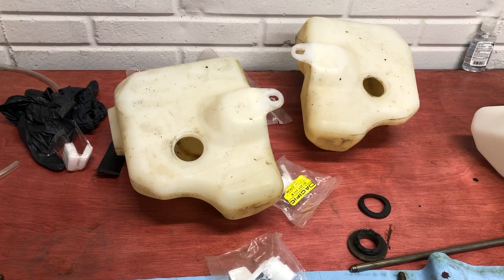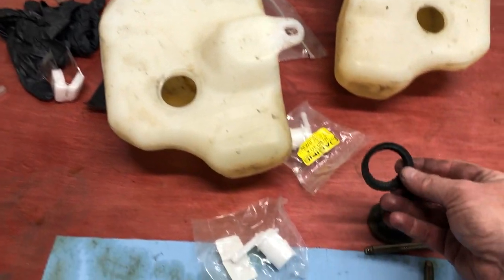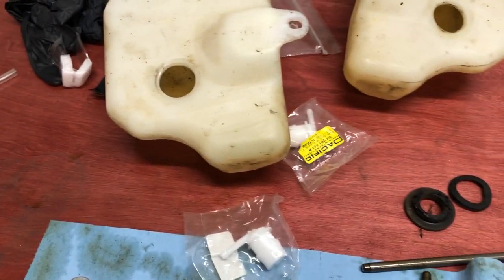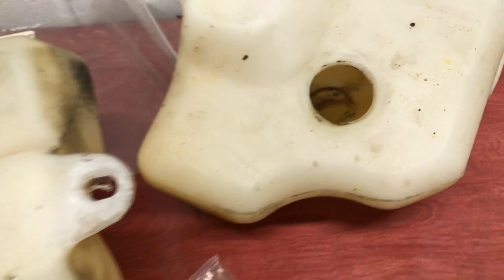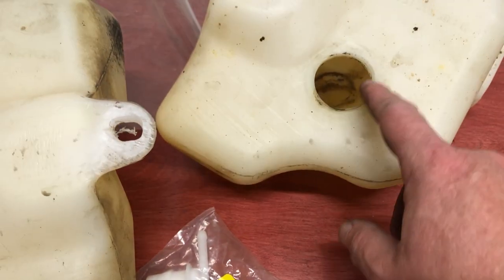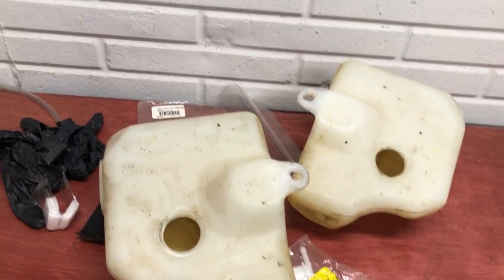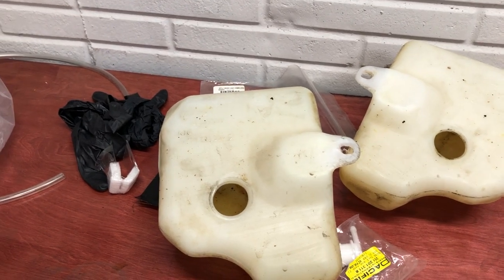Your grommets are probably crap. Case in point, here is one of the grommets from mine. One part of it I think I may have even thrown away, but you can see inside this tank the fuel grommet had completely dropped off the hole and down into the tank. What happens is that is a really good place for all of this rain and grit and water, especially if you're going through mud puddles and things like that.